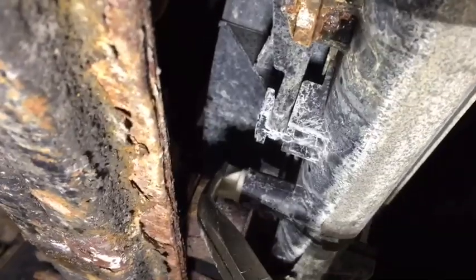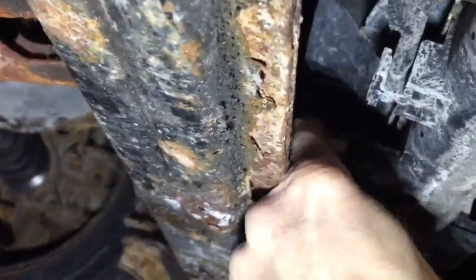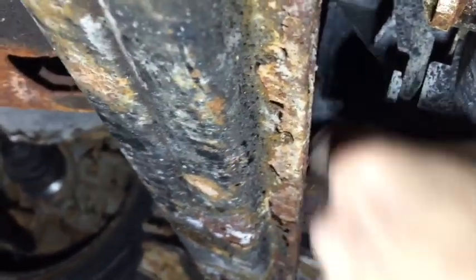I've got a pair of offset pliers here and hopefully this will do it. It's plastic, so don't overdo it or you'll be sorry — there'll be coolant everywhere as well. This draincock has certainly never been opened by me, but there we go — let that drain.